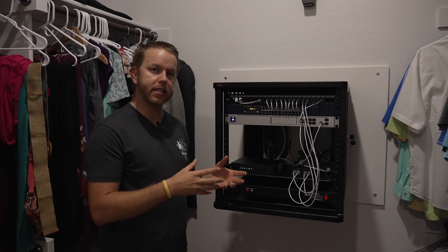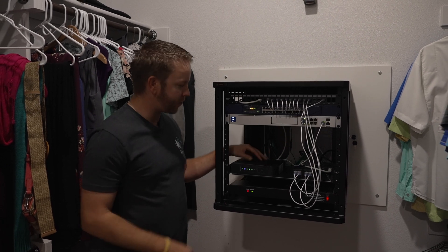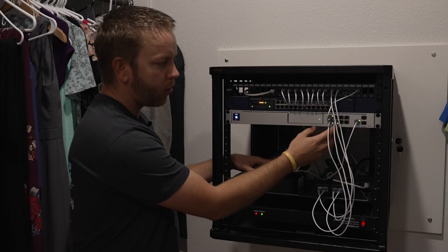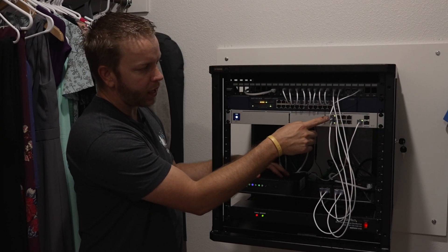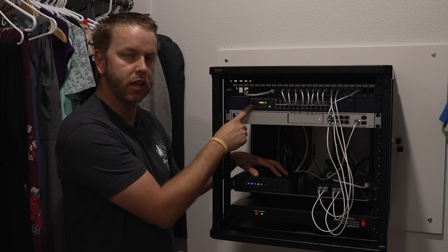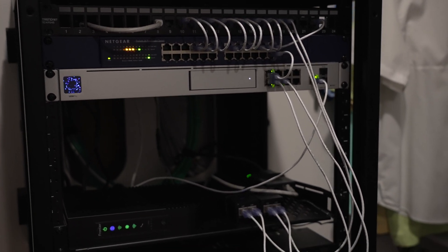Let me walk you through how my home network is set up after this upgrade. My internet service provider comes into my house via Ethernet into their modem and router. From their router, a Cat6 wire powers my UDM Pro. The UDM Pro has temporary Cat6 wires connecting to my PoE injectors for my Ubiquiti AC Lite access points. From the UDM Pro it goes into a little patch panel, then into my switch — an old Netgear switch I'll be upgrading to a Ubiquiti PoE switch in phase two. From the switch it goes into my patch panel and disperses throughout the house to my iMac, living room TV, other TVs, access points, and cameras.